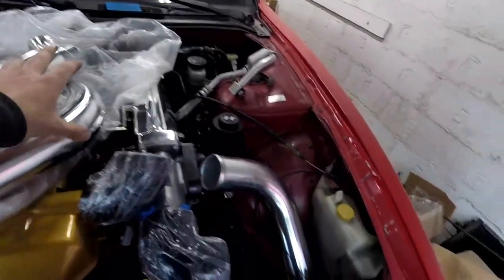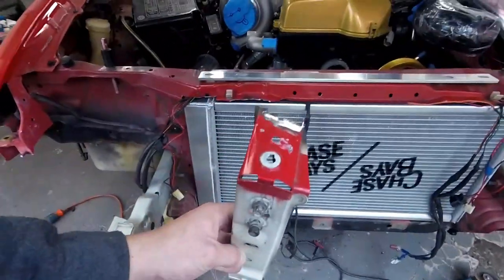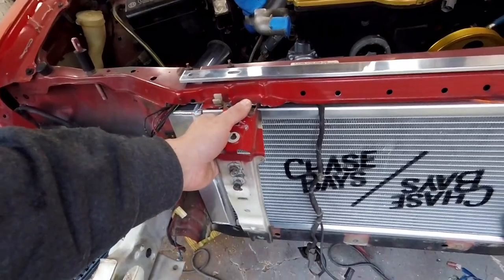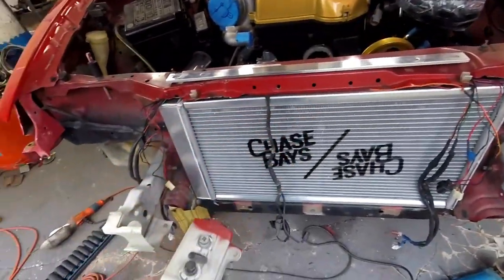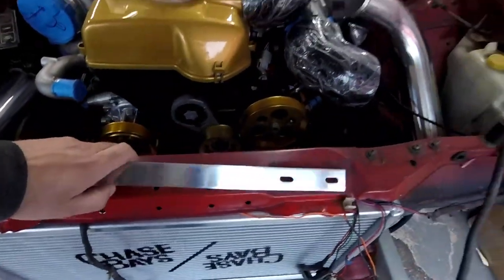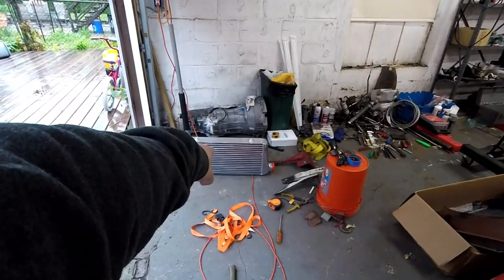I got a little bit excited and I want to mount the intercooler. What I'm going to do — which is another video — is straighten these pipes out, cut them nice and straight, cut off these tabs, drill two holes, and put screws on there so this is removable. I'll put it into these little holes and it should hold. I also got this bracket from CX Racing — I'm going to cut it, make an angle out of it, and use those little slits to bolt the intercooler to it.